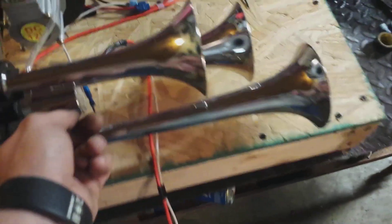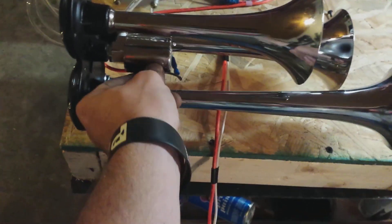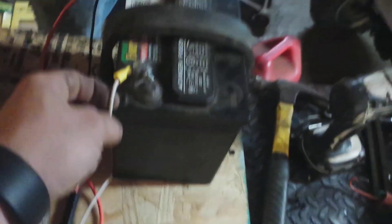For your hot wires, you have one main hot that will go to your air compressor. Then you have another hot that comes all the way down here — I have it run along this strand — to a toggle switch. And if you'll listen, there's a little solenoid right here that's clicking. After the hot wire runs to the toggle switch or push button, whatever you want to do, it will run up to this wire here. You'll have two wires coming out of your solenoid: one wire will be hot, one wire will be ground. The ground runs over here and connects with a splicer with the ground off of the air compressor pump, then runs up to the ground on the battery.